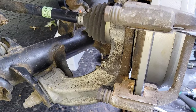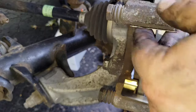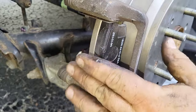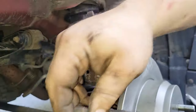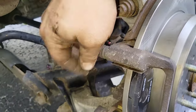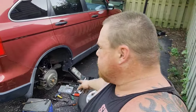Let's go ahead and pop this old hardware out and get some of this new stuff in here. Line it up — it fits right in there. Let's get a brake pad here, see how it slides in there. Nice and easy — make sure you put it in there correctly. You know what to do with the caliper slide pins: pull them out, wipe them off, re-grease them, and throw them back in. Do that every single time — because if these things get frozen up, you're going to have problems. Go ahead and put this bolt in and hand tighten it, same thing at the bottom.